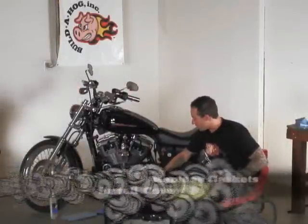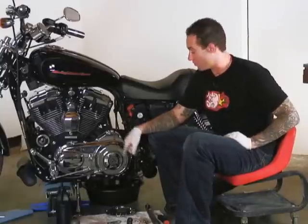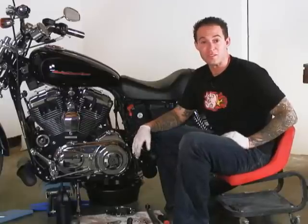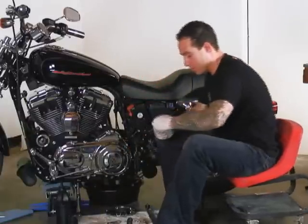With our two gaskets installed, I'm going to go ahead and start putting our covers on. But before I do that, I'm going to put a little bit of anti-seize on all of the threads for the bolts here. It's standard to see these get stripped out, so you want to get as little friction on them as possible, and anti-seize is a big help for that.